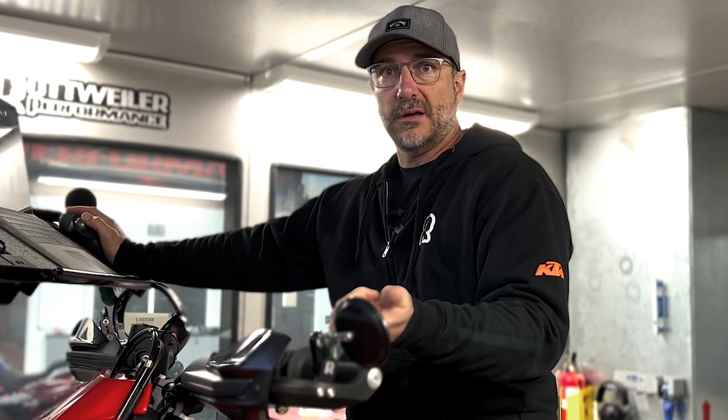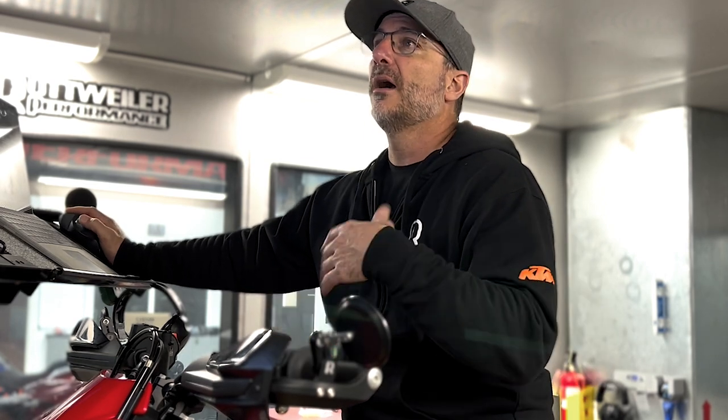And that allows us to show people, listen, we made horsepower at all throttle ranges, not just wide open. If you're looking at a chart that just shows 100% throttle, you may be losing horsepower at 60% throttle or 40% throttle, and they're not showing it to you. So we do every one of these runs.